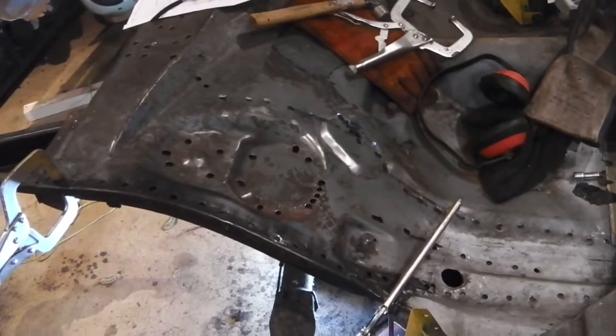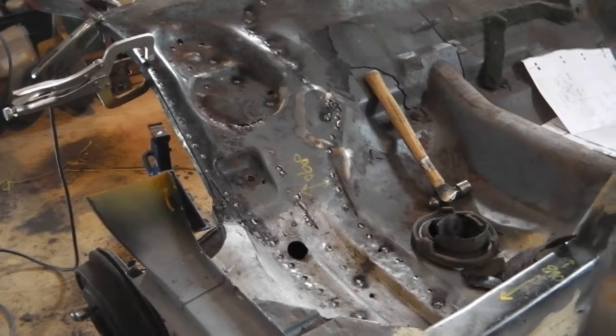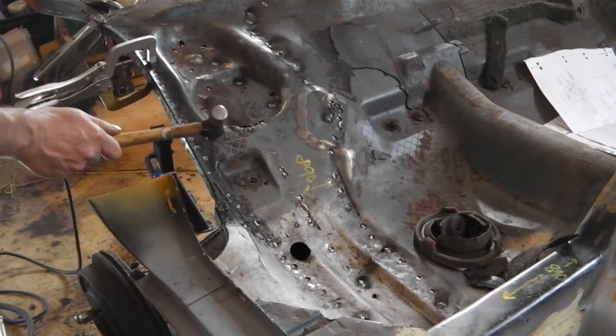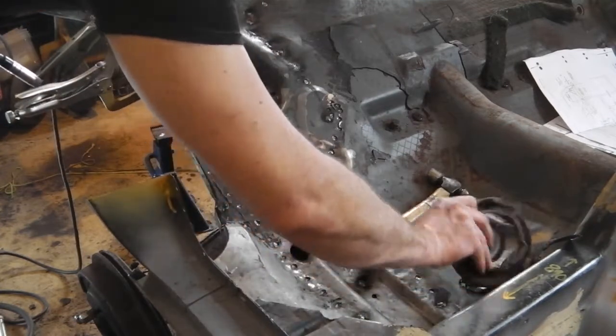Saturday 10th of March 2012. The over-axle chassis piece is all now set up. I've taken all the measurements and it's correct: 890mm front section across, and 1228.5mm back of the chassis leg across to the back of the other chassis leg. So all the centers are correct. Welding torch is on, getting the mask. I've clamped everything up, put a couple of tacks in already. I've had to tap lightly just to get it to fit — there's been some damage to the floor when we took the old one off. But we're there now, so the weld's going to go in.